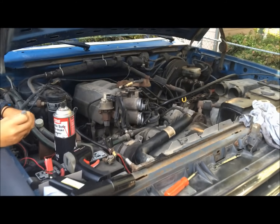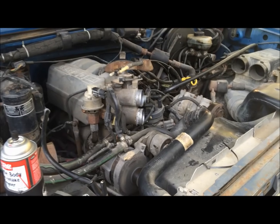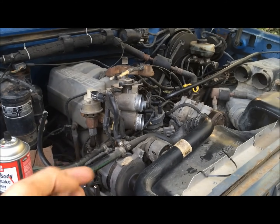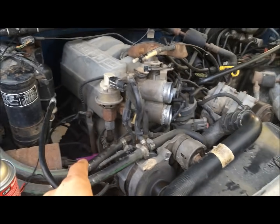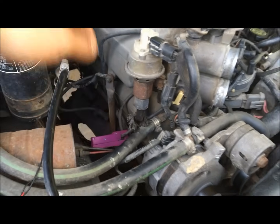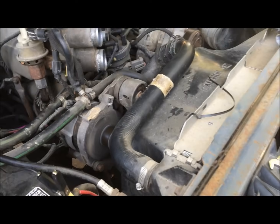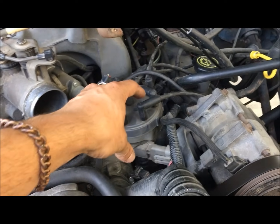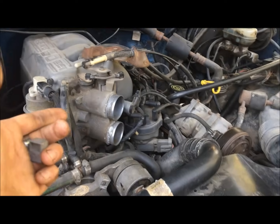Here's the process to set ignition timing on these. You want to make sure your engine is fully warmed up and down to its idle RPM. Once it's warmed up, shut the engine off, hook up your timing light — I have a video linked in the description on how to use the timing light. You hook onto spark plug wire number one, aim it down at the crank, and it flashes to show you how many degrees of advance. Rotating the distributor clockwise advances the timing; counterclockwise retards it.